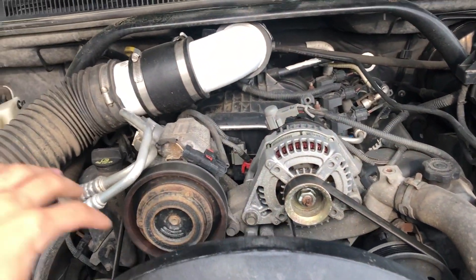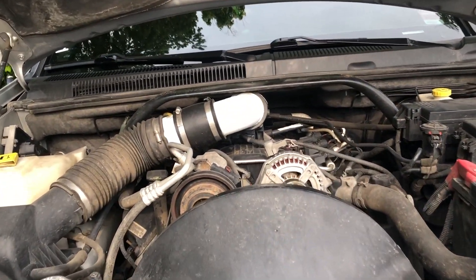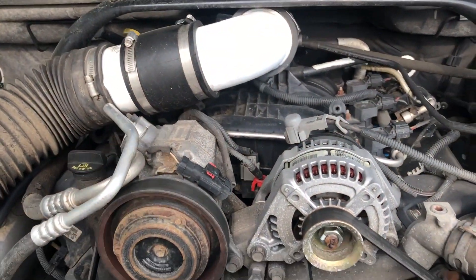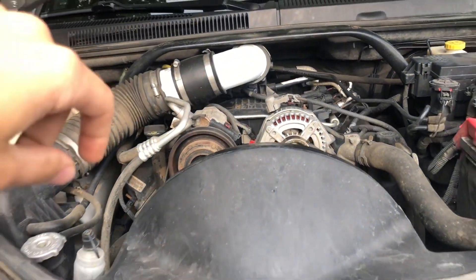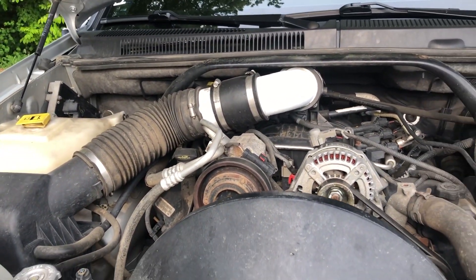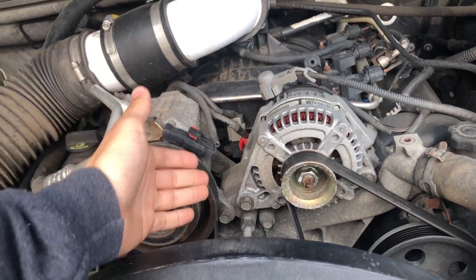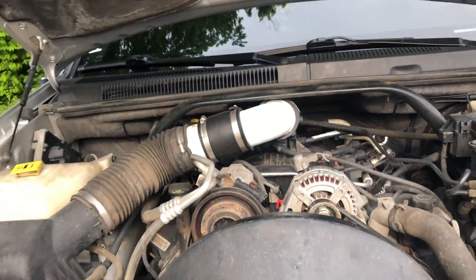Keep in mind this was on a quite hot engine, so everything down there is hot. I had gloves on while reaching in there — I tried without them and was bumping my hands on hot components and was not having a good time. Untwist it, take it out, and put your new one in from the parts store. Make sure it has thread locker or sealant already on the threads — you'll be able to see it on the top part. That's the seal so the coolant doesn't come back out once the system gets pressurized. Just swap it in, snap the clip back on, and you're good to go.